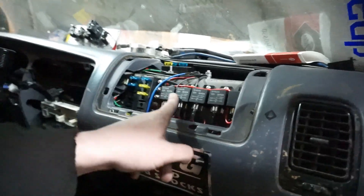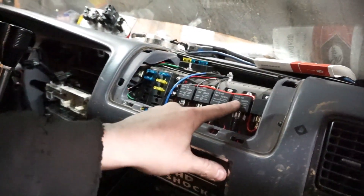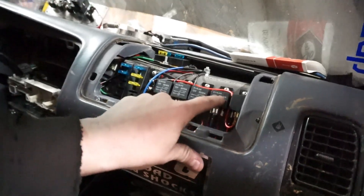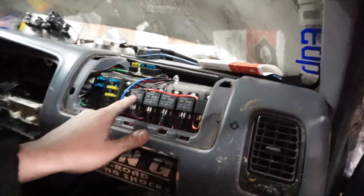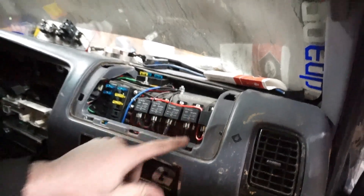The next day I came back out, got a voltage gauge, and checked the voltage. Key on, it was about 12.5 to 13 volts. As soon as you go to start it, it would drop down to about 5 volts — not enough to kick on all the relays. Only the first two were kicking on. The first one kicks on the circuit open, which sends power to the next two. One sends a signal back to the ECU, one actually sends power to the fuel pump. So the fuel pump wouldn't kick on — obviously causing issues. Put a new battery in it. Works great. What are the odds?